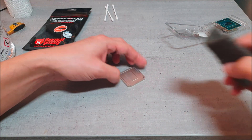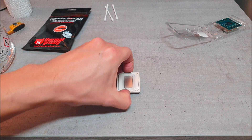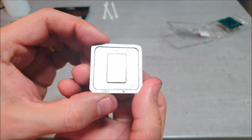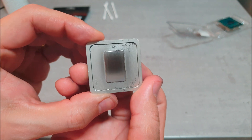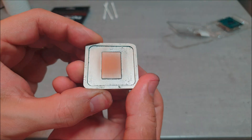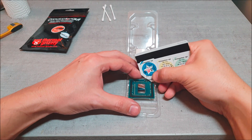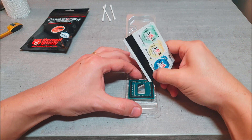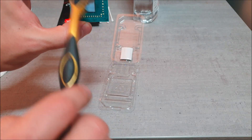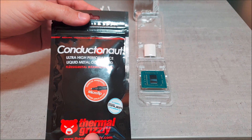Let's go ahead and clean this up. I got this with Liquid Ultra, but you can also find these at a local hardware store. I like to do this with the dies because it creates microscopic scratches — microscopic valleys — therefore increasing the surface area and also helps the liquid metal bond with the IHS better. That way it's not all dripping around in there; it stays where you spread it. You don't want the stuff running over the capacitors around the cores, because that'll be the end of your CPU.